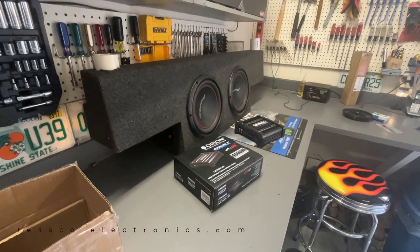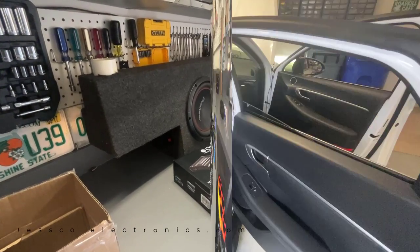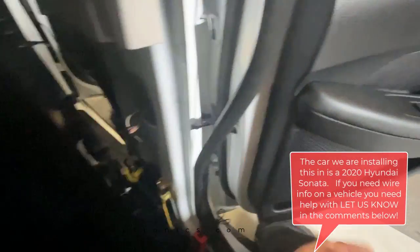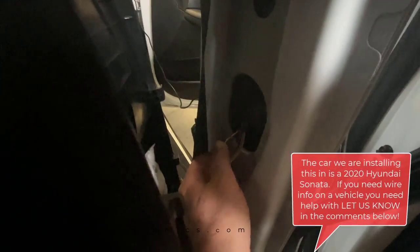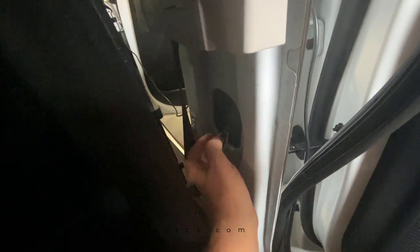Hopefully we'll see if this thing sounds good when we're done. I've got my helper up front doing the power cable for the battery. In the meantime, back here, if you pull up and pull back this panel, you'll find the harness going through the door boot into the speakers where we need to tap the audio signal from. In here is a twisted set of leads - in the right rear on this one, we've got brown and white. That's going to be our wires to tap for audio signal on the right side.